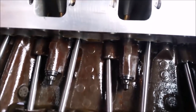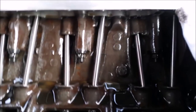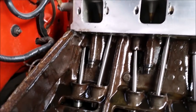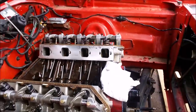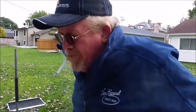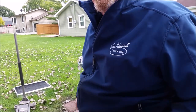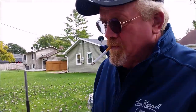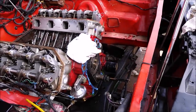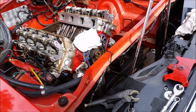Studs that are screwed into the heads and then they go right in the valley. That's part of what makes a Hemi special. And then of course where the push rods go, it's all special in there for Hemi only. A 440 ain't got any of those provisions. Whereas you can just sit a Hemi head on a 440, you can't actually use a Hemi head on a 440 without a lot of modification. Ain't really worth it. And a Hemi block, there are a lot of things that are special to a Hemi block.